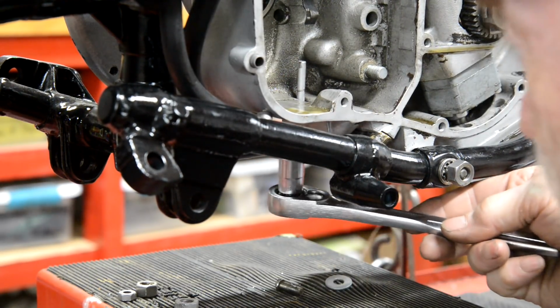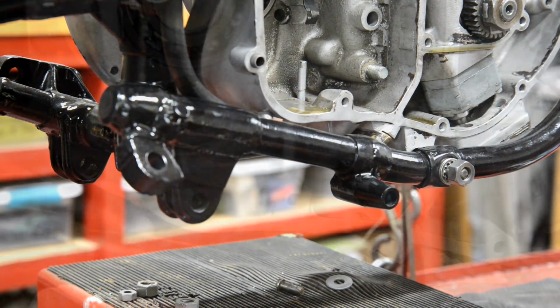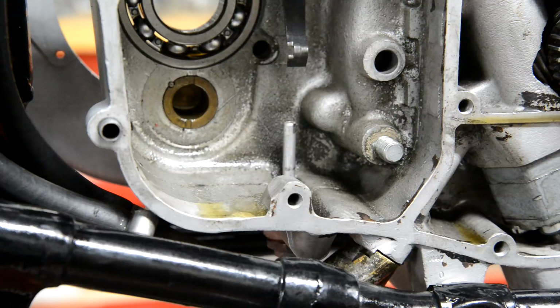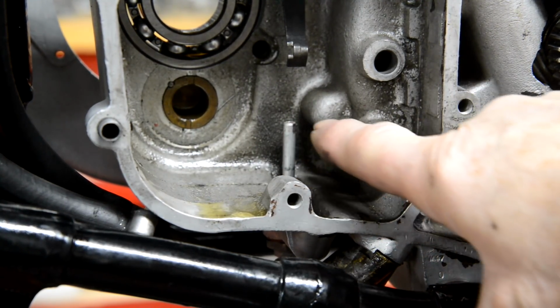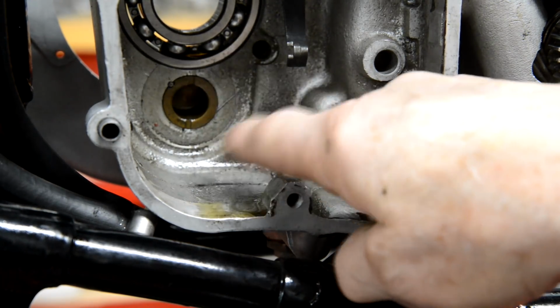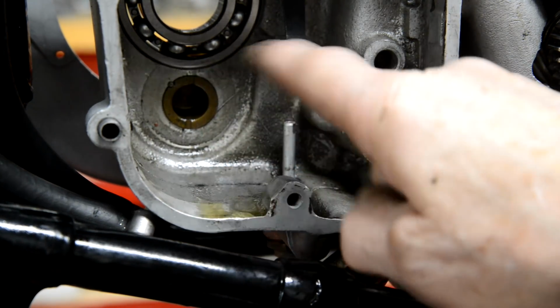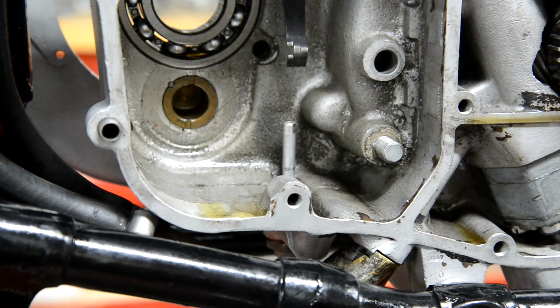That must have been a bigger one. Alright, let me get the right size socket for that. There it is in. I've moved you around so you can see. You see how small an amount of oil actually goes in a gearbox. It's just enough actually to catch the lay shaft here, and that throws the oil around everywhere and that lubricates things. Okay, next thing.